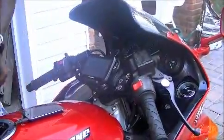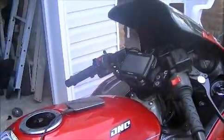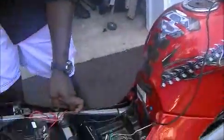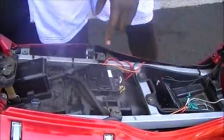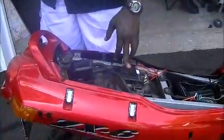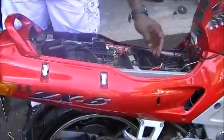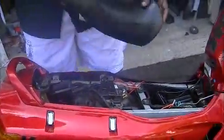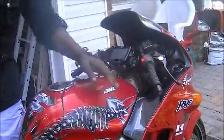We got that wired up — let me open this back up and show you guys how I did it. The best way is with the 12 volt adapter — you want to hook that up to the back battery so whenever the bike is on, it's on. You don't want to drain your electrical supply, which is underneath this chassis harness right here. Everything's hooked up to the brake light, so when I turn the key that's when everything lights up. The LED lights I put on a manual switch so I can turn them on and off as I please.